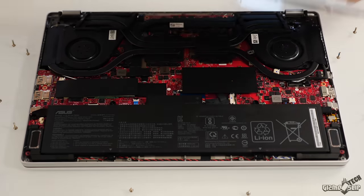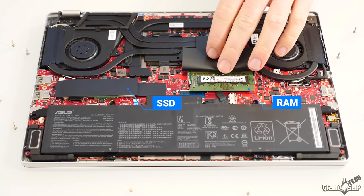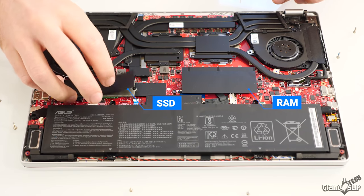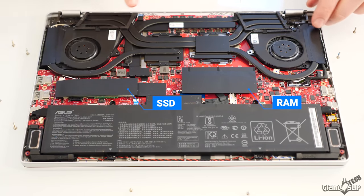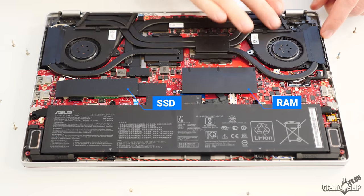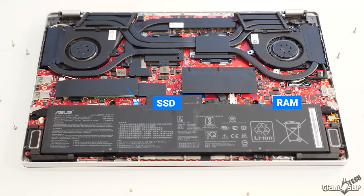This machine comes with a one terabyte SSD, which is quite generous for the $1,400 price point. There is some upgrade ability — you can take the bottom off and upgrade the RAM from 16GB dual channel 3200MHz to 24GB dual channel 3200MHz. You can actually go beyond that, but 8GB of the RAM is soldered onto the board, so if you want dual channel memory for maximum performance, you'll need to stop at 24GB, as dual channel is not supported beyond that point.